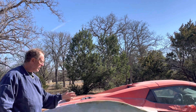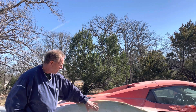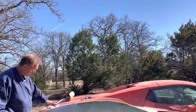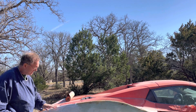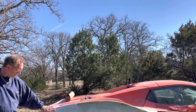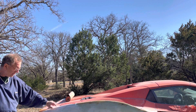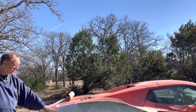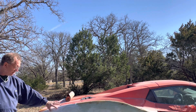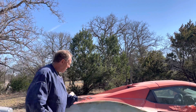What I ended up with was that pink foam on the inside going all the way up to here. This area right here is a combination of plaster of Paris and body filler — plaster of Paris only where I sanded through the body filler to get the shape I wanted. So this area is plaster and it's not even attached; I could pick this off with my fingernail. I'll have to literally do that and put a little body filler there so it has some substance to it.